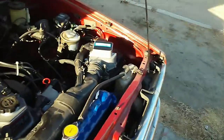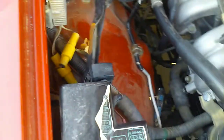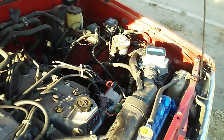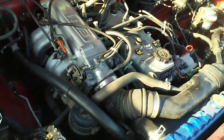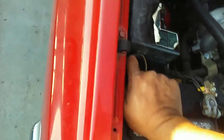We got the air flow meter in. There's that new one with all the other new parts — this is going to be a pretty tight little truck. Let's start it and see what happens. Wait — gotta clear codes first. We took the jumper wire out of the diagnostic connector and put the cover back on. Disconnecting the negative cable wipes out the memory. Just do it for a few seconds. This has been quite a job — it's been here a long time, I finally got it done.